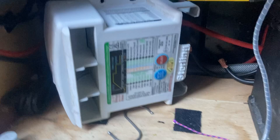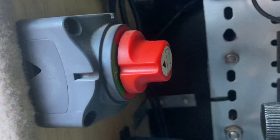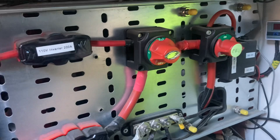I've half-unscrewed it because I can't get into the terminals — I've shoehorned it in there. Before doing anything I disconnected the earths and I've got isolators on both sides of this, which is the safe thing to do with any high-current cabling. In a van you want to be able to isolate individual bits, and for the cost of a rotary isolator — about a tenner — it's a no-brainer.